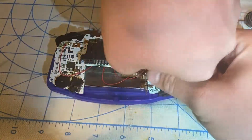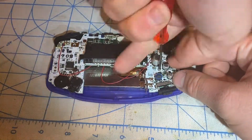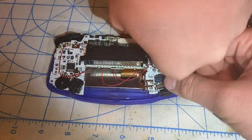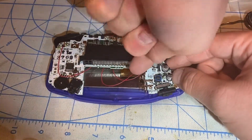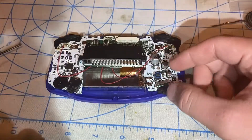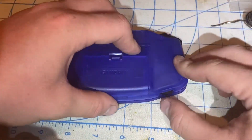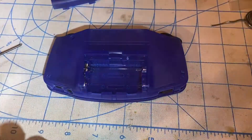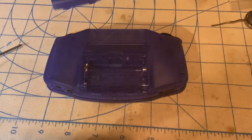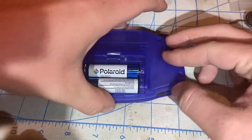The reason I want to test the brightness control right now is that I want to test it on both the Funny Playing IPS V2 ribbon and the unbranded IPS V2 ribbon. So I'm going to put the backplate on, insert two AA batteries, and now turn it on.